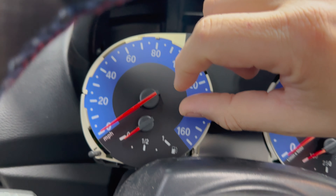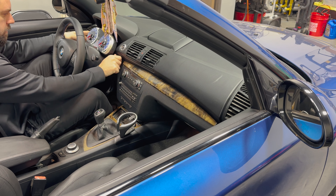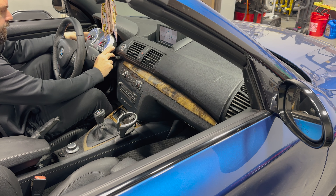The fuel adjusted — that's what we want to see. I'm going to initiate a gauge test now. Key off, hold this down, tap it once, KI test, press and hold. Now we want to see that the range is realistic. I consider that dialed in — I'm going to push these flat down. I had that pressed a little bit too far down so it was touching and causing resistance; now I know we're ready to put the cover back on. If you want to test the gauge sweep, you'll hold this down, put the key in, tap it once, it says KI test, let it sit for a second, and tap it — it'll sweep through everything and make sure everything's good to go.